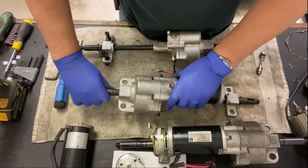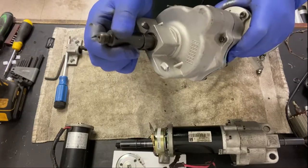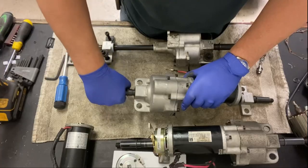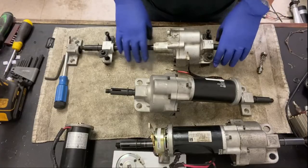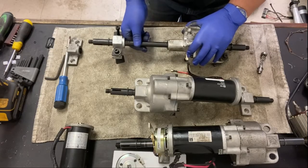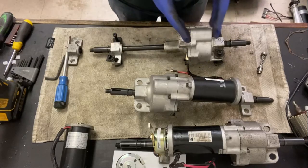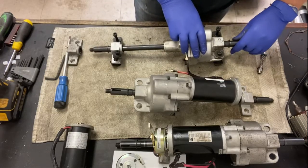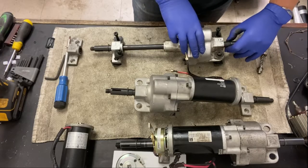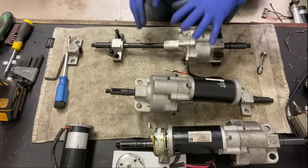It should be at least a couple of millimeters, maybe no more than a quarter of an eighth of an inch. I have to try and think about the difference between eighths and millimeters, but 2 millimeters is pretty excessive. It's a bit too much, and that would say to me that that's starting to wear or has worn. Especially this side, it's like 3-4 millimeters there. So it's a good way of checking to see if there's any wear and tear to the transaxle.